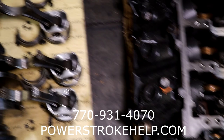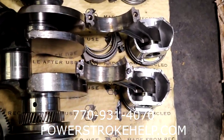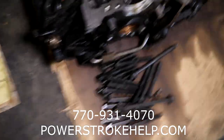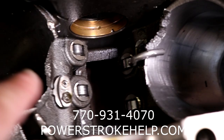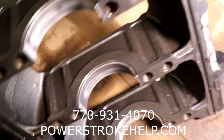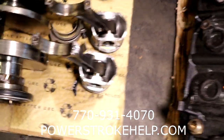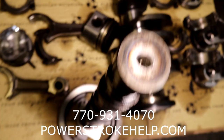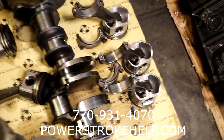The engine failed because of a broken rod bolt and a broken piston in cylinders seven and eight back here in the back. It trashed the block — took pieces right out of the block back here. It chucked a hole in the side of the motor right down there. The crank is all tore up; you can see right here where the crank got beat up. The lobe on the camshaft back there got beat up, so we trashed a bunch of really good parts.